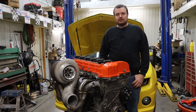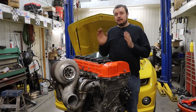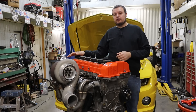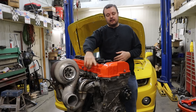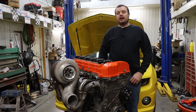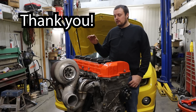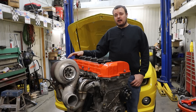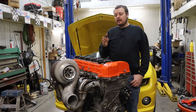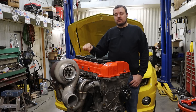There's one small problem, and it comes in the form of this little solenoid right here. Holley can control the fuel and spark for the later 58 tooth Vortec 4200s, but they cannot control the variable valve timing. I've been hearing through the grapevine that some of you have been pestering Holley to add support for these engines, and I've even been hearing that Holley has told some people that the variable valve timing control will work on the later 58 tooth engines.